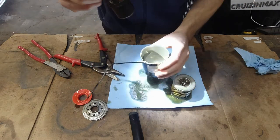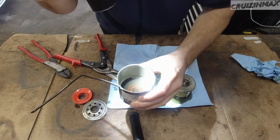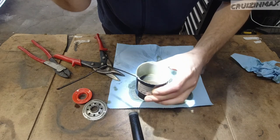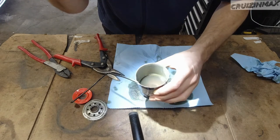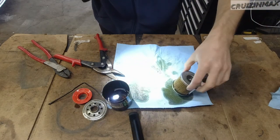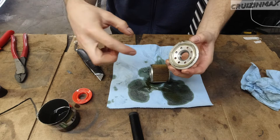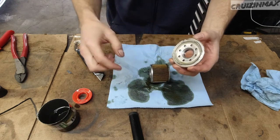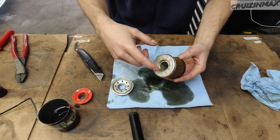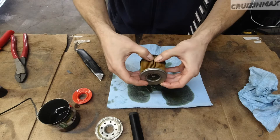I'm going to take a look inside here. Don't be fooled by the bubbles in the oil — I can see a little bit of shiny stuff, but remember this is a relatively new engine so some of that is not surprising. As for how the filter works: oil comes in from the engine through these outer holes, passes through the filter media, and exits from the center back to your engine. So it's in from the outside, out through the middle.